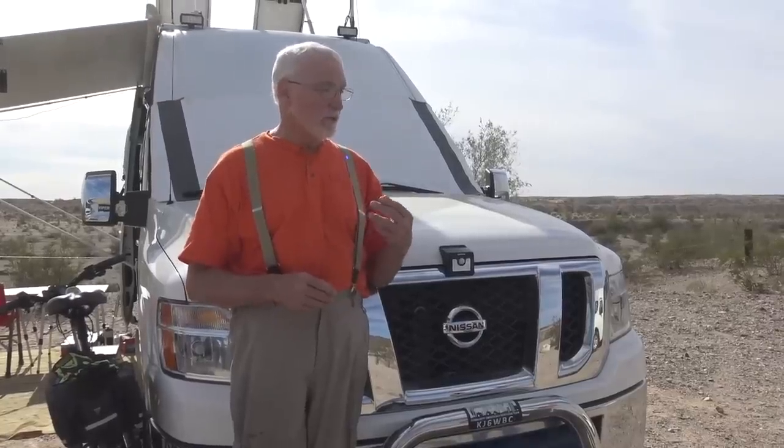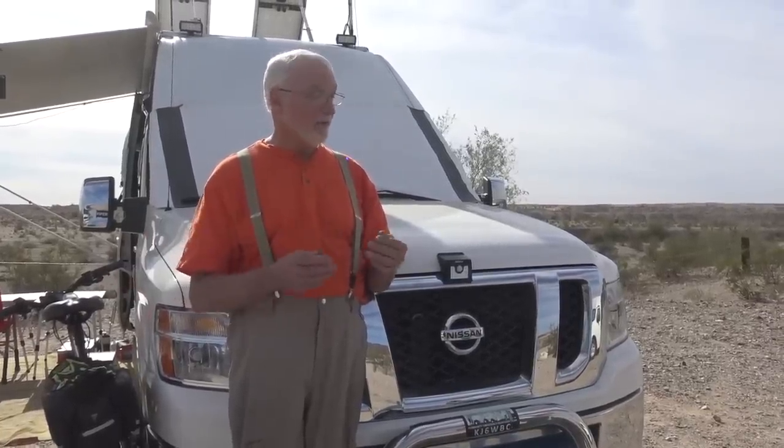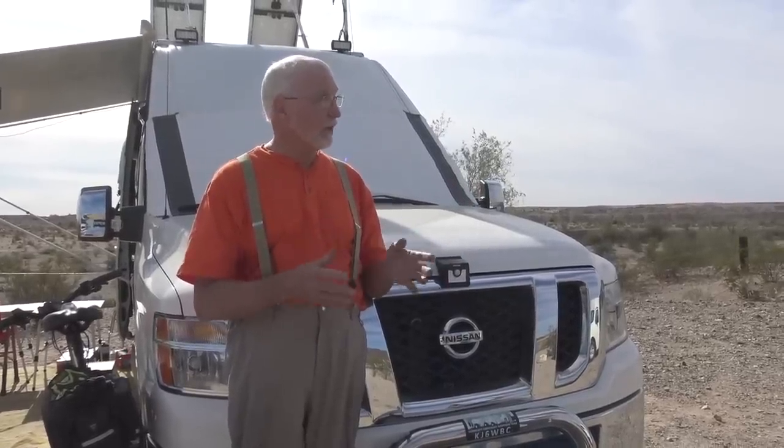If I'm going to be somewhere for a long time and I'm fixing breakfast for a number of people and I'm going to be using more power in the morning, I'll switch the front battery in, and now I've got 535 ampere hours to play with, because I know I'm going to be here and I know it's going to get recharged. I can bring that extra 105 ampere hours in just with the flip of a switch on the control. And it's the same battery anyway.